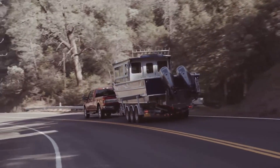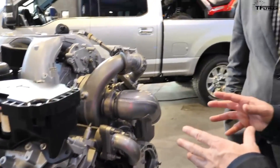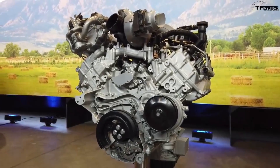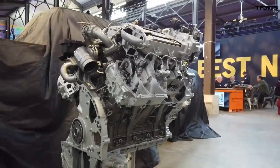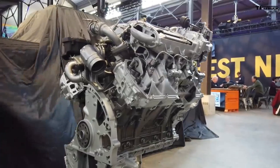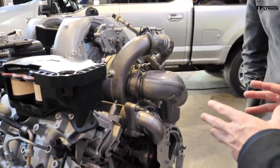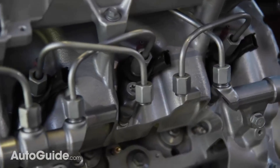The next thing is the intake manifold. Right after the turbo, air comes out of the turbo, down into an intercooler, and out of the intercooler into the intake manifold. The factory manifold on the 2017–2019s was plastic. The 2020 is now a two-piece aluminum unit. They also added thermal plates between the cylinder heads and the intake manifold to reduce heat transfer, so we get colder air in there and make more power.